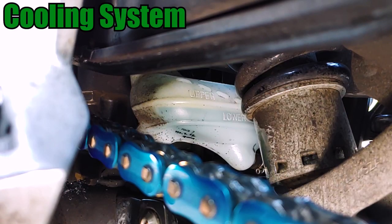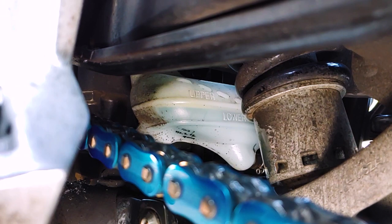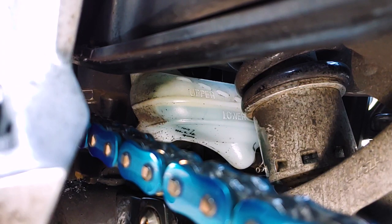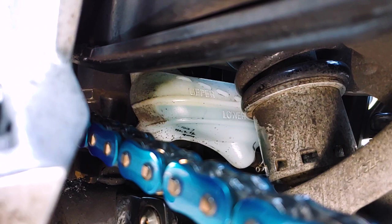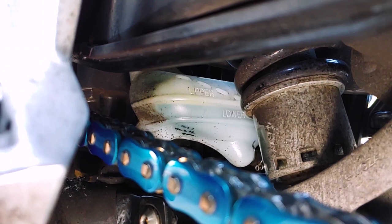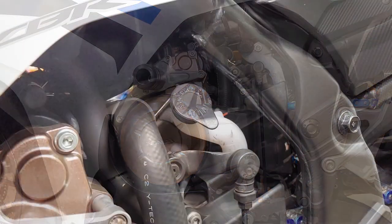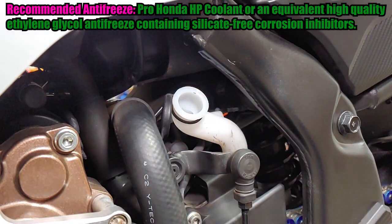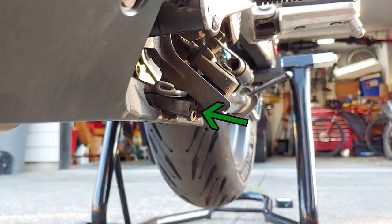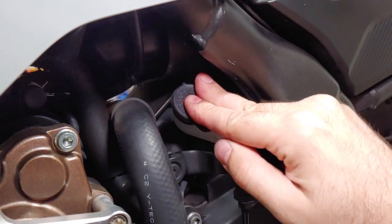The coolant level can be checked at the coolant reservoir, which is located in front of the lower rear shock mount. There should be fluid visible between the upper and lower lines on the bottle, with the bike upright on a level surface when the engine is warm. If the coolant reservoir is completely empty, it's possible that air could have been sucked into the cooling system — to purge any air or replace the coolant altogether, check out my coolant flush video. But if you just need to top off the reservoir, you can add some here. Overfilling won't hurt the bike, but excess coolant will drip out from the overflow hose as it heats up, so make sure the overflow hoses are directed up and away from the back tire. If the coolant level drops significantly over a short period of time, check the rest of the cooling system for leaks.